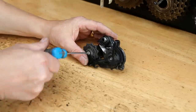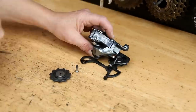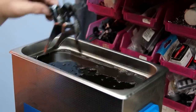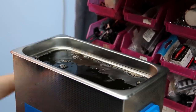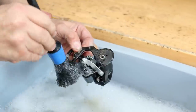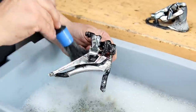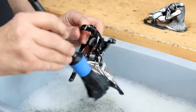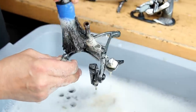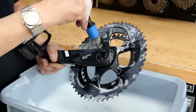We're detailing this frame, so we're taking the bottle cages off. I'm going to strip down all the components and put them through the ultrasonic cleaner, determining what to clean by machine and what to do by hand. I'll run them in the ultrasonic cleaner for around 15–20 minutes and then wash off the degreaser with nice soapy water, since this is a water-soluble degreaser, making sure all components are nice and clean before lubricating.